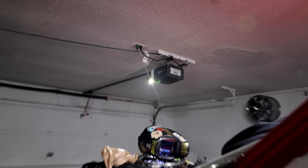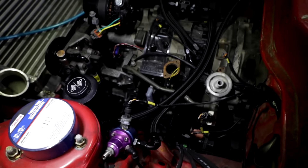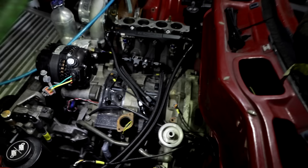I really need to work on the lighting in here — I only have two lights, so I have to rig up one of my snap-on lights. The surge tank is in. Up front, we have all the lines plumbed — from the fuel rails to the regulator, down to the fuel filter, as well as the plug wires that run under the fuel lines so they won't touch them. That's all done.